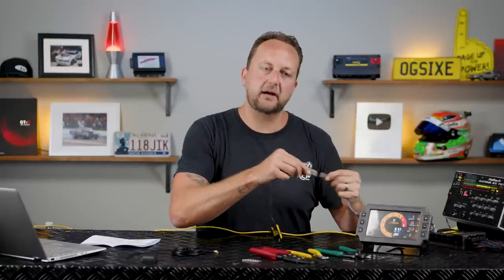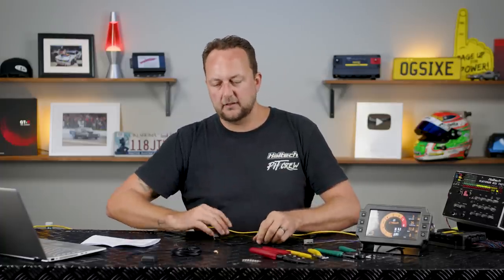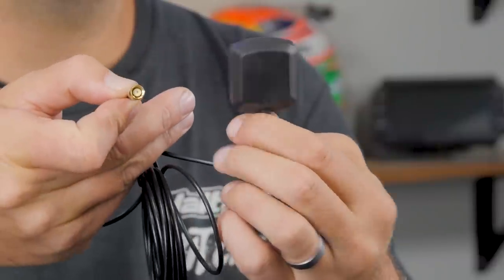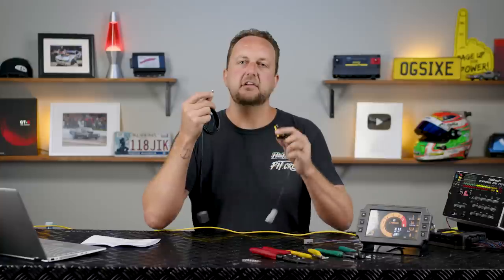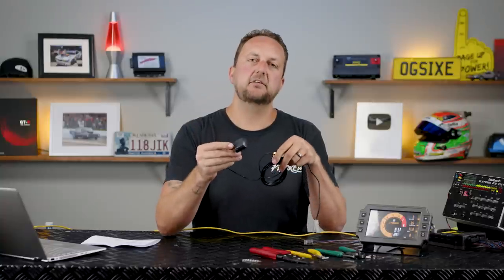Now let's get to wiring it into your dash or into your ECU. The parts supplied when you buy the GPS puck are the main body with a Deutsch DTM 3-series connector on it, supplied with its mating connector — one has female pins, one has male pins. It also comes with the GPS antenna with a length of cable. The idea is that the GPS puck will be mounted near your dash or behind the ECU, then you screw the antenna on. That cable will run all the way up — you might want to sit it on top of the dash or put it on the roof of the car to get better GPS reception.